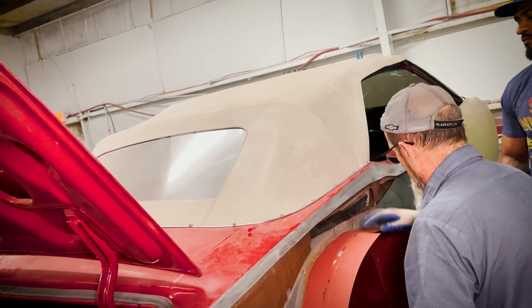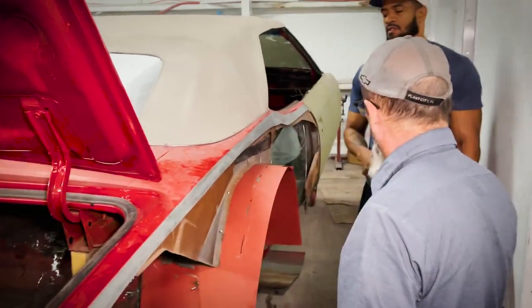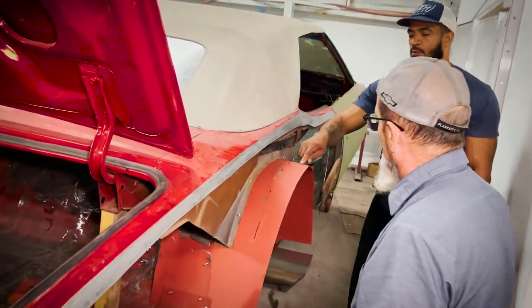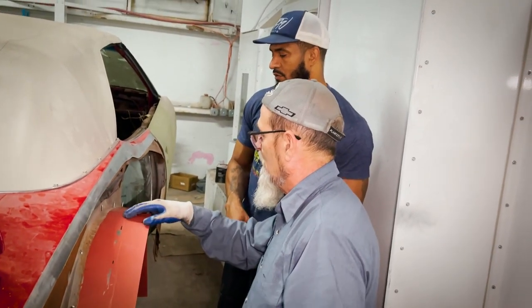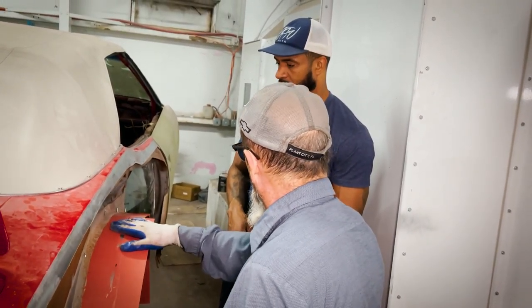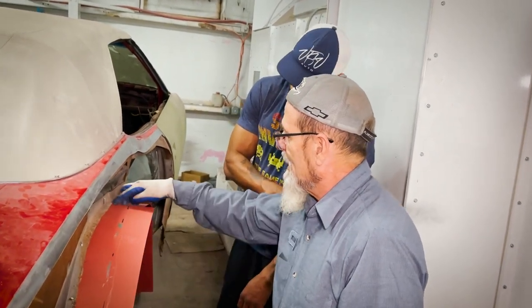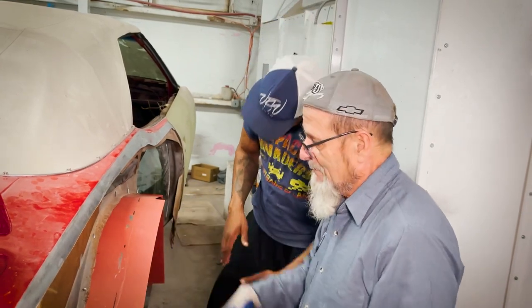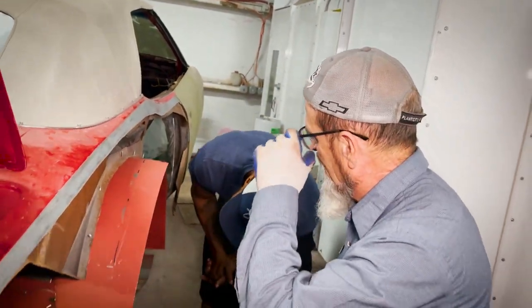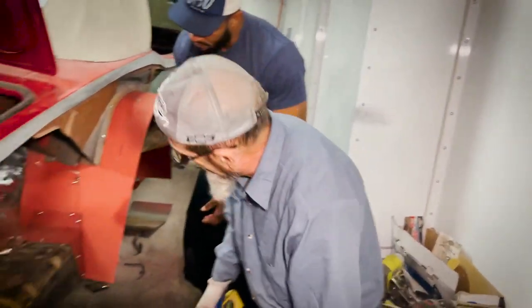This is basically seeing how much we have to trim, because I made these wider since we weren't sure what we had. That's going to be butt welded in when it's all there. I might butt weld it in one piece and put it in one piece if it stays shaped nice. That's what I'm thinking — welding it off the car, tack it on here, weld it up, put it in. Done. That way it looks like one piece. We're in the fabricating stages of it.